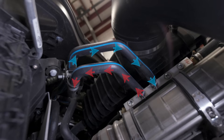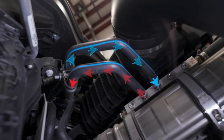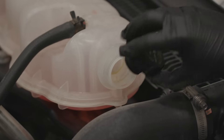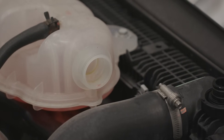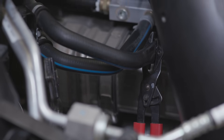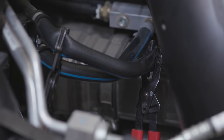Before you start, it is crucial to identify the direction coolant moves through the truck — inspect the truck's engine or look through the truck's owner manual. First, remove the radiator cap and release the system pressure on a cool engine. Never remove the cap if the engine is hot. Next, it's helpful to clamp the truck's coolant hoses to minimize coolant waste. Now, plumb the heater to the truck's coolant system. When you're done, refill engine coolant to the OE's recommendations and reinstall the radiator cap.